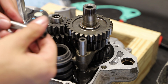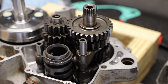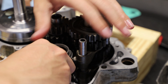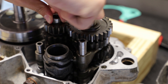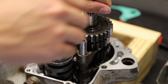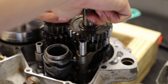Unless these shift fork pins have a recessed edge, they aren't really directional — though that's not always the case. A quick way to test this before we put the cases together: in first gear, the transmission shafts won't spin independently. Finding neutral — halfway up — I'll spin everything a little bit and throw it into neutral. Now this transmission shaft spins independently from the other one. We'll click it down to first: shafts locked together. One click up to neutral: both shafts spin free. That is what you want to see.